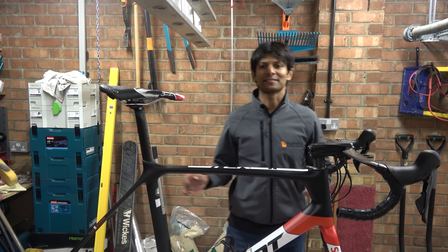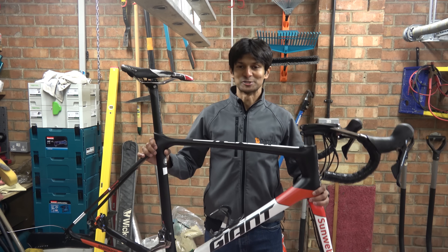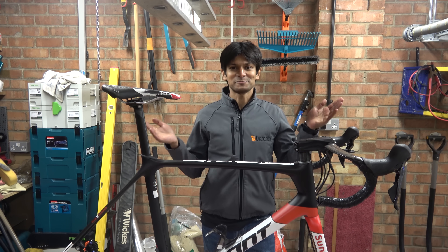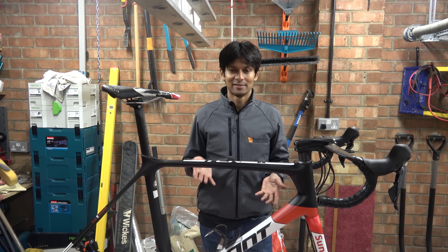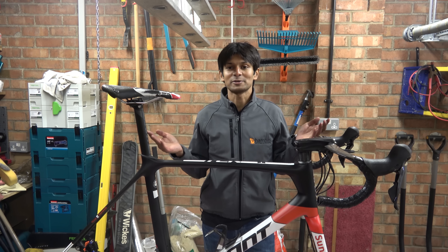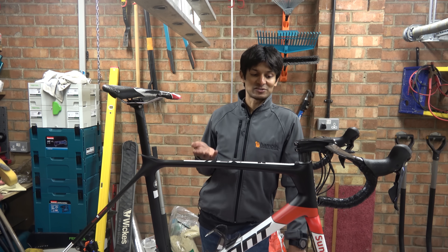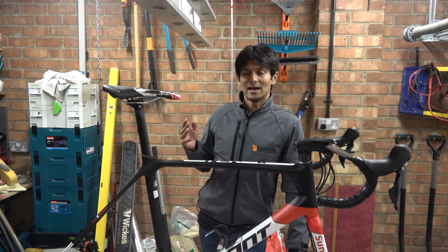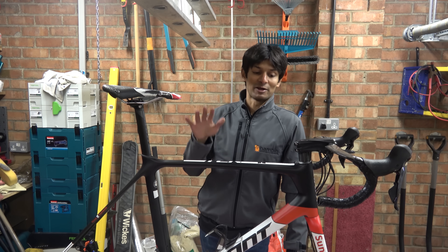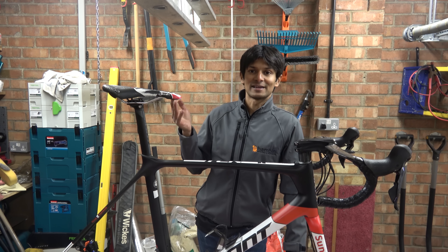That's us complete and that brings us to the end of this video. The takeaway: this frame is honestly quite poor. It's supposed to be a team frame but the internals weren't great and the bottom bracket was a shocker — I haven't got a good word to say about it. I would avoid it. It could be a one-off, but I don't know how it could pass QA/QC being so undersized. Do comment below — it's a Giant frame, historically considered quite good — but here, when actually measured, it didn't come out well at all. Until next time, keep banging your hairdresser.